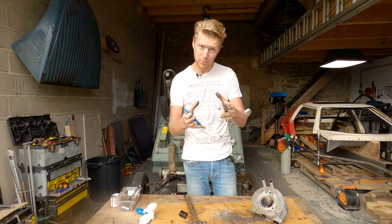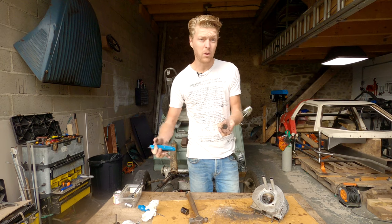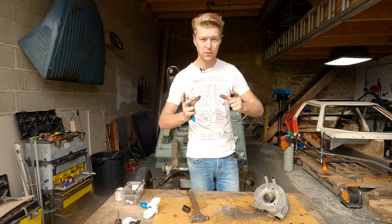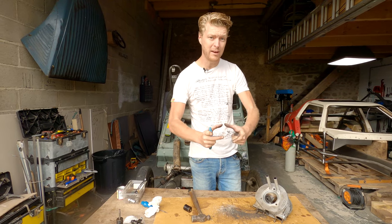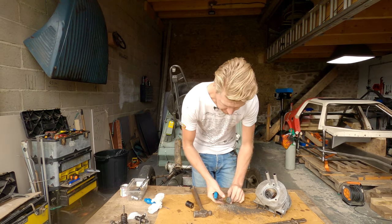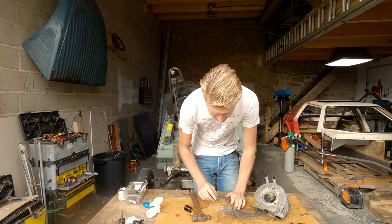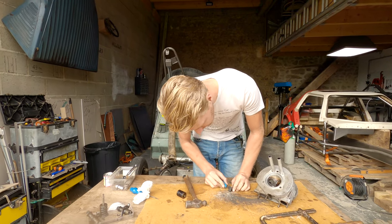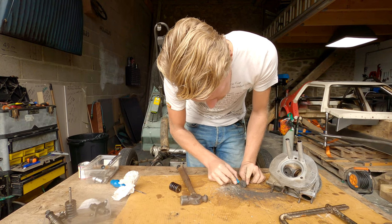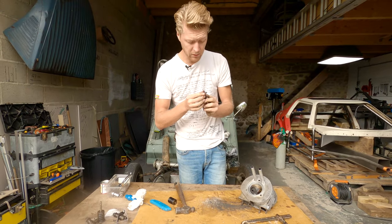The more compression you have in that chamber, which is dictated by things like your fuel quality and your engine and all of that, the more that you can compress the fuel air mixture in that chamber before you ignite it, the more power you get. That's how normally aspirated engines make power. But if it's not a sealed container, then it's barely functioning as an engine. So the good news is it's really easy to sort out. You know, it's not the end of the world.